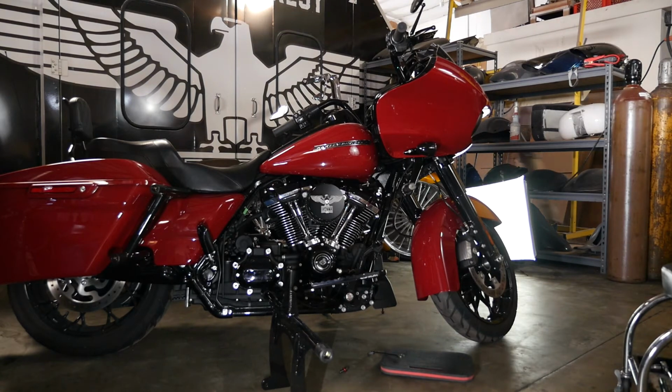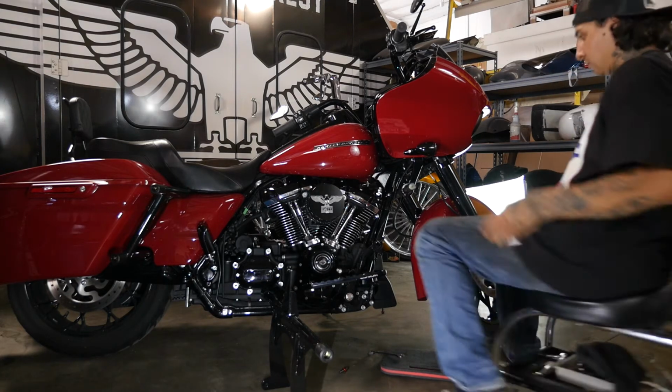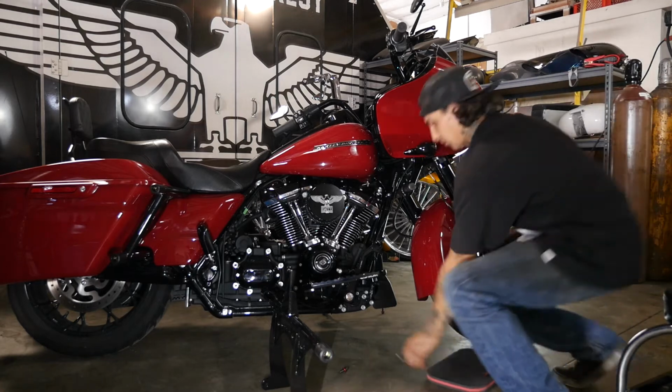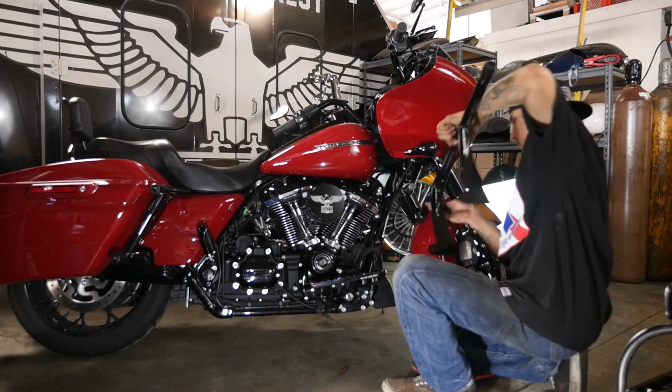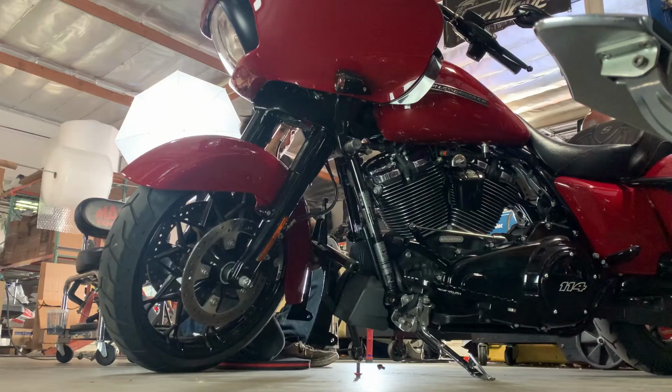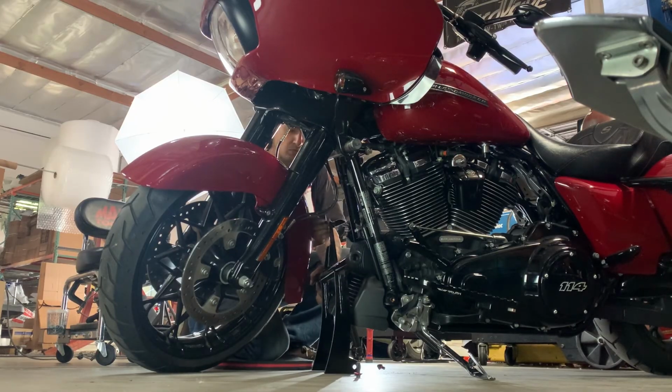After you've locked it down, go ahead and get your Imzz Elite 2.0 crash bar. You're gonna go ahead and take a 5/16-18 center bolt, get the top mounted up loosely, and then just go ahead and swivel that crash bar forward and get the two bottom bolts inserted.